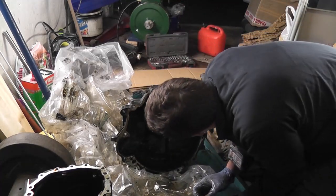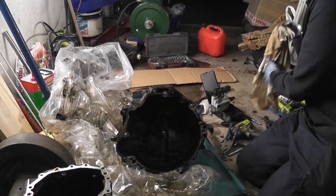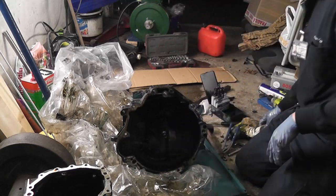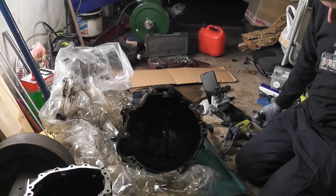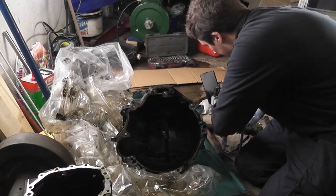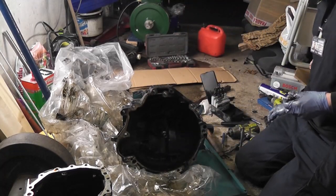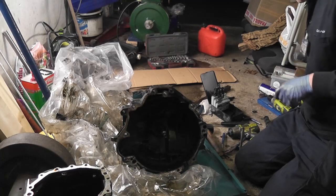Bearing housing in here. So there's three little Torx bolts there. So let's get the clutch release arm out of the way. Okay, I think we're back onto our T45 Torx by the look of things. So wherever that's gone, ah yes, on my input. The right size anyway, but we are not going to use the impact gun.